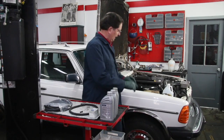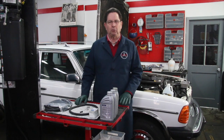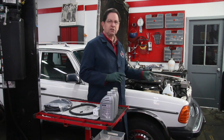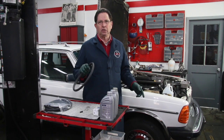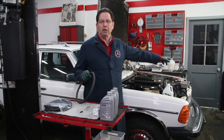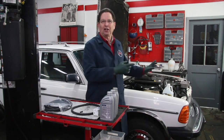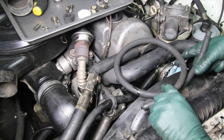In preparation for doing a flush of your SLS hydraulic fluid, there are a couple things you need to be aware of. I always change the filter right here. Before you even plan to do this, inspect the hoses. There are two hoses — one is a low pressure return hose from the bottom of the reservoir here that goes over to the pump on the front of the engine. That's a braided hose, and I would say about seven out of ten times when I look at these old wagons, that braided hose is wet and weeping fluid.